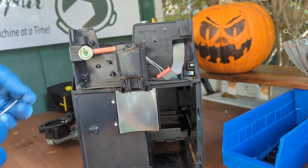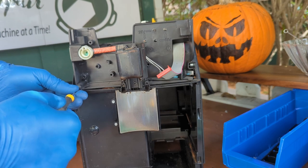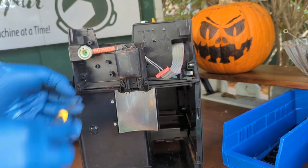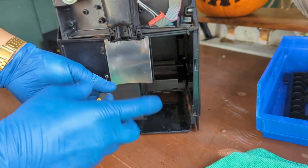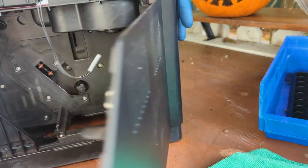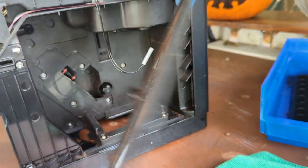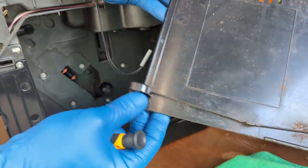Okay, now that we're back, let's start with this screw. I haven't touched anything. Let's just remove this screw. This one is holding the frame. Okay, there you go. Another screw. Another screw. We open this thing, and then this is very easy to remove. Once you have the whole frame, this one just goes up. So you can always do that. You're going to open this door, just do that, just remove it. You don't want to snap any of these little tabs, which are very, very easy to snap.